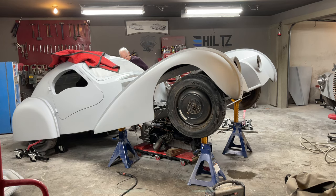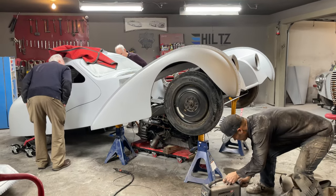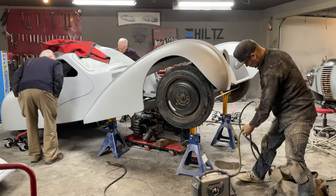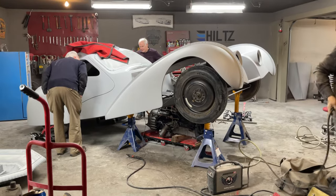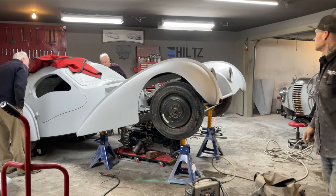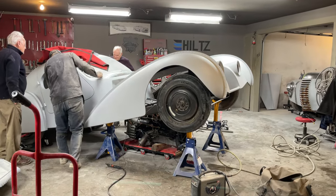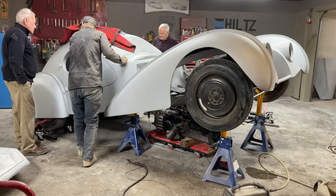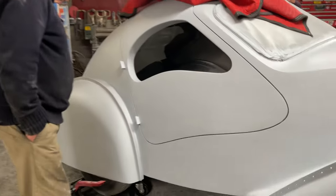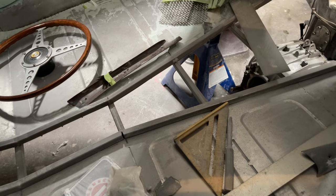Do you think you should cut off that first cross member that you cut? I'm not sure when, but I'm going to have to, to get the transmission in. But aren't you going to have to take all of those out for your drive shaft? Maybe, possibly, yes. And that drive shaft will only be 2 feet long anyway. The thing that I like to do with the cross members is go across there and then cut them off whenever I want to. You know, the first one would be good. You mean cut them now? Sure.